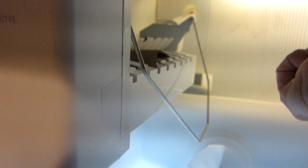Okay, I'm now going to put the wire back. You could use a mirror to help with this to see the correct orientation, but I'm going to try to do this by feel. There I've got it. Push it forward, and now to turn the unit on, push the wire down. Now it says here to allow 72 hours for ice storage to fill. And you may have to wait at least 12 hours before it cools down and produces ice cubes, but in this case, this fixed the ice maker, and I hope it does the same for you.